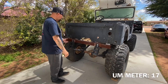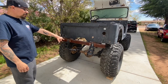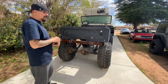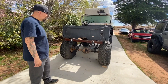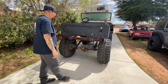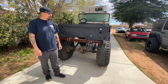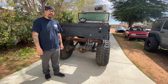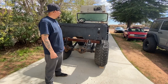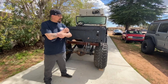This is where the stretch was done, and I think we're going to have to redo some work on the bumper — I'm not real happy with it. It's a little crooked and they weren't precise with their welding. In the back we have a Dana 44 stock axle, but that's not going to stay either. We have a Dana 60 coming for the rear, and a Dana 44 in the front — that should be plenty for the 36s. Even if we decide to go bigger, I think a built 44 up front will be fine for 40-inch tires.